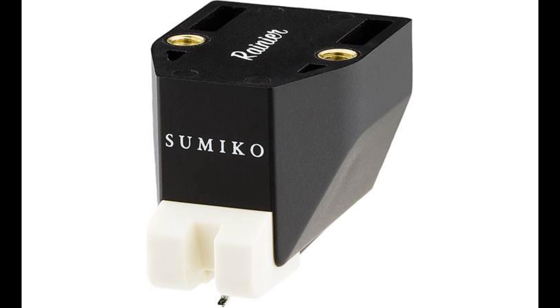The problem with this cartridge is distortion — a great deal of distortion. It does not track well at all. You can hear distortion even on extremely clean records that are not over-modulated or heavily worn. This cartridge just has a distorted sound. When it comes to sibilance — high frequencies like people saying the letter S, and cymbals — this cartridge will really emphasize sibilance. It's not so much mistracking as it just sort of sounds gritty on the high end. Once you notice it, you start hearing it everywhere. I also ran into a lot of inner groove distortion on this cartridge, on two different turntables very carefully aligned by myself.